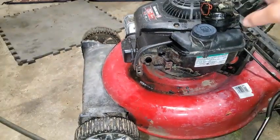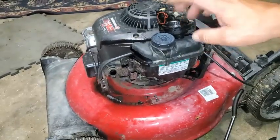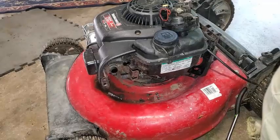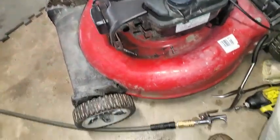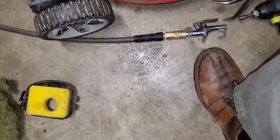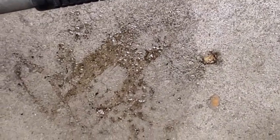I've got the carburetor up here now. I dumped out a little fuel but I'm going to go grab a jar. When I took that carb off, some of the fuel spilled down by that hose right there, and the gas itself has evaporated — but if you look real close you can see what's still shiny there. That's water that'll be left over. That means there's water in that carburetor, and most likely there's some water in the gas tank as well.